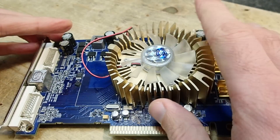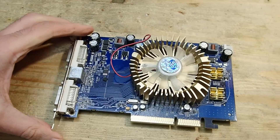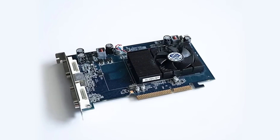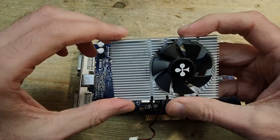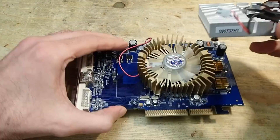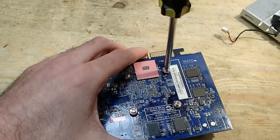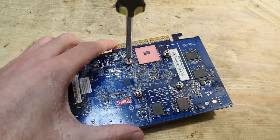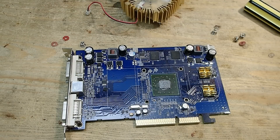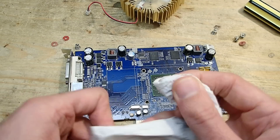The previous owner also glued small heatsinks on two of the eight memory ICs. However, one slightly touches a capacitor — probably not deadly but not nice — and the other is tilted to the side with almost no contact to the IC surface. The DDR2 memory on this card shouldn't get really hot when not overclocked, so such heatsinks are not necessary. Furthermore, if they were necessary, it would be better to cool all eight ICs, not just two. I have a silver cooler that looks extremely similar to the original — let's see if I can restore the nearly original look.